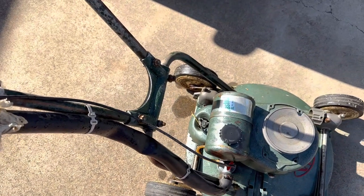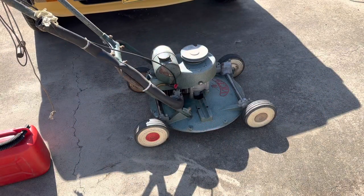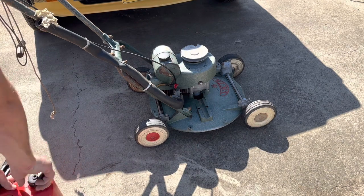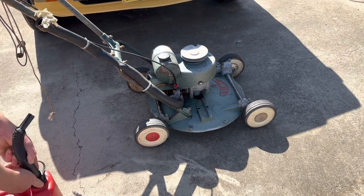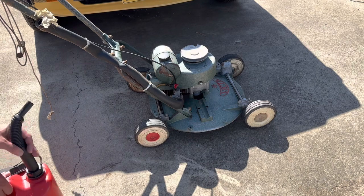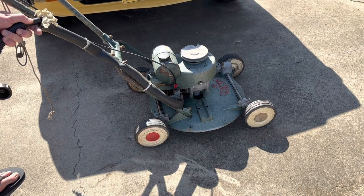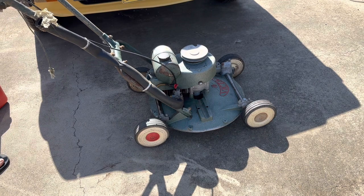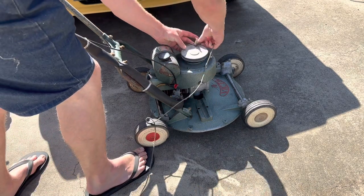So I'm just gonna leave it sit out in the sun for a little bit, dry off now, and then we'll rip into it. Oh yeah, well, might dump a little bit of two-stroke down this snorkel here. Unfortunately, the original air filter housing, I suppose you might call it, was just basically fly mesh in the box thing, choke on it, it's missing. Just dump a little bit of fuel down it. Dribble. And on wide open throttle, see if she lights off.